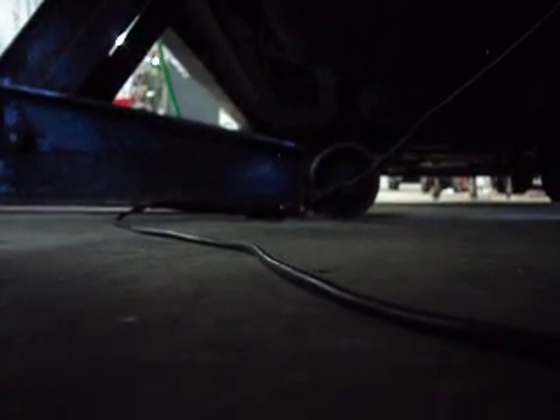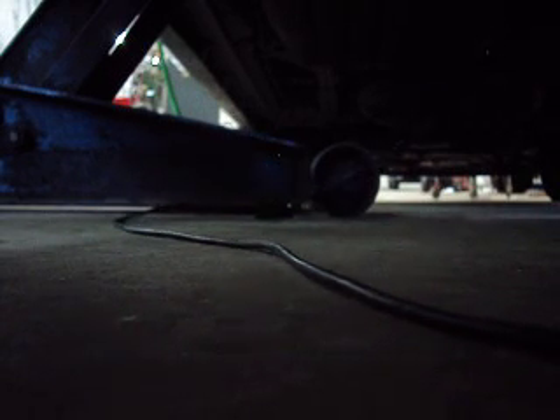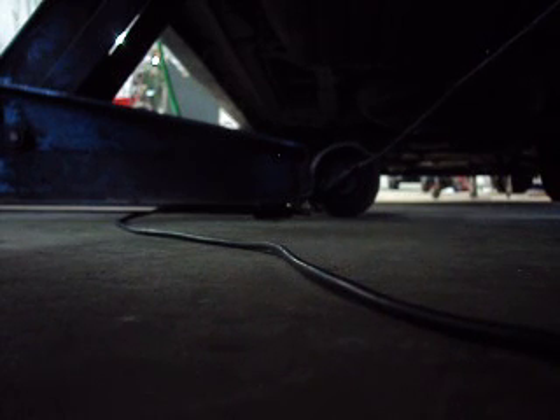I should mention that the key is on on the vehicle. I got my ground lead with an extension going all the way up to the driver's door striker. On the pictures I posted on the forum, the wave signal was looking kind of fuzzy — I think that was because I had a rusty ground connection back here. I also got filters turned on on all three channels.